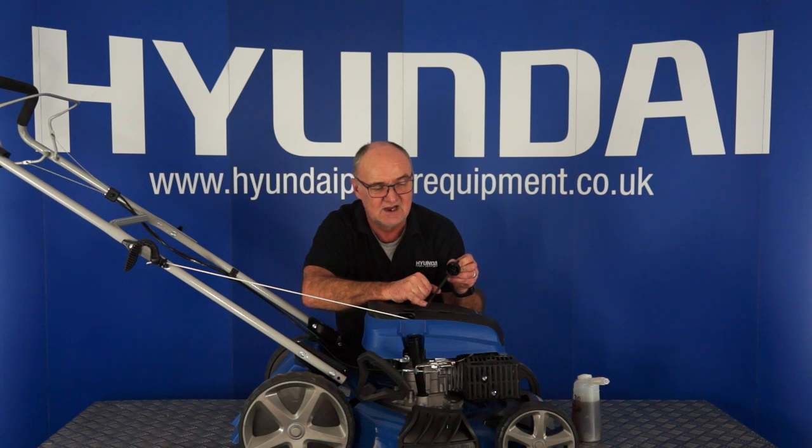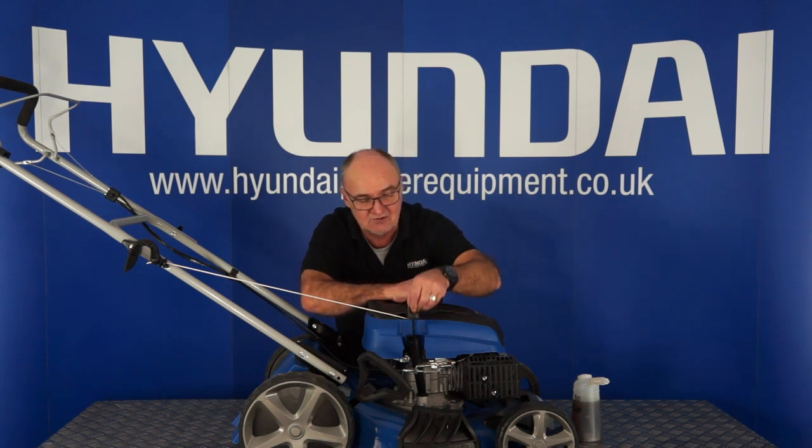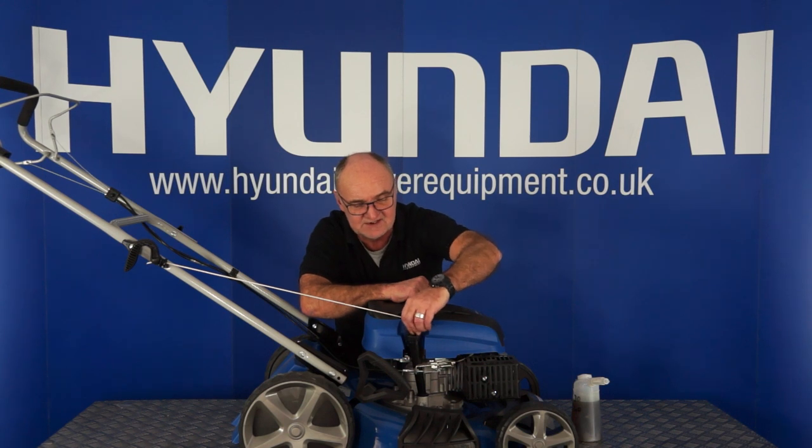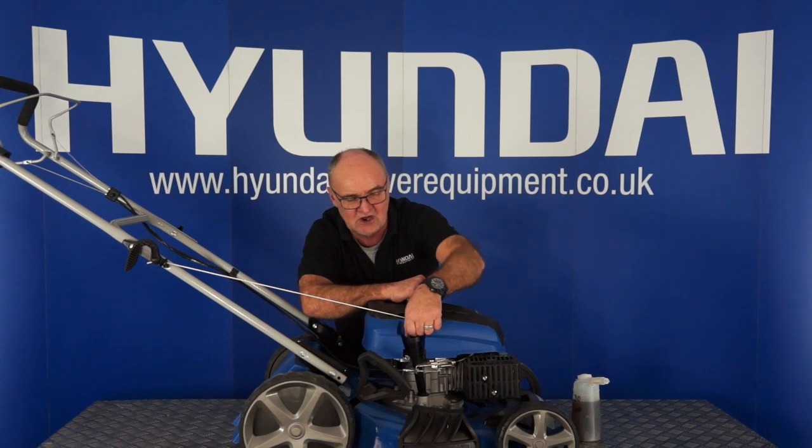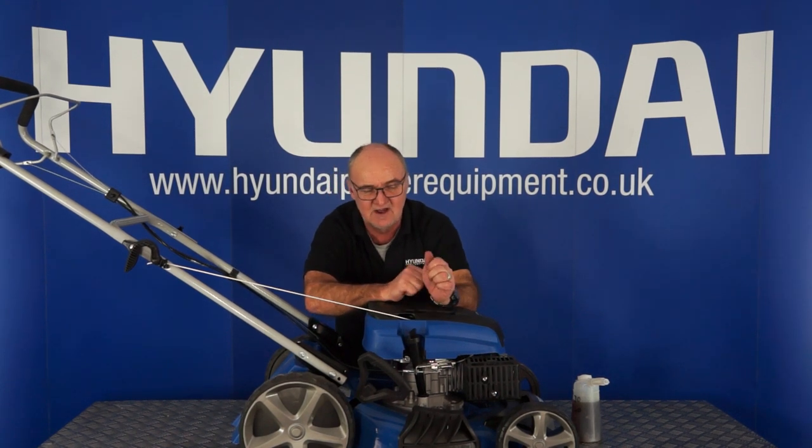on the bottom of the dipstick. As I say, continue filling it in until you get to just below the letter H on the top line of the cross-hatched area. Once it reaches this level, your engine oil is correct. Replace the dipstick, turn clockwise until you reach a stop, check it's in there tight, and that's your oil filled.